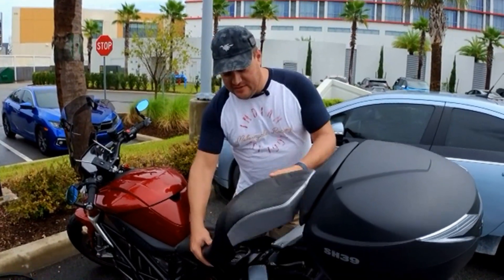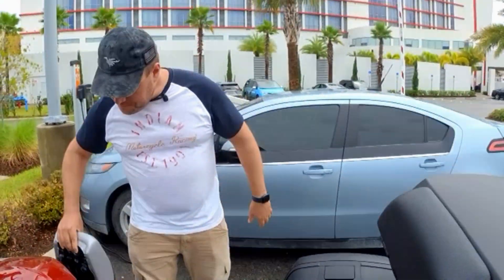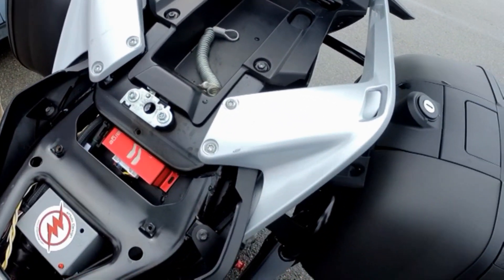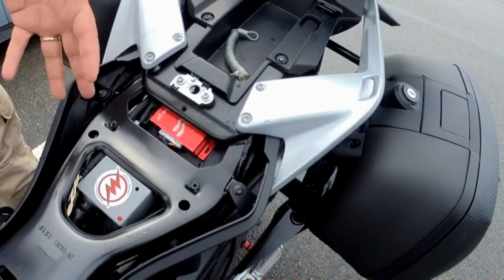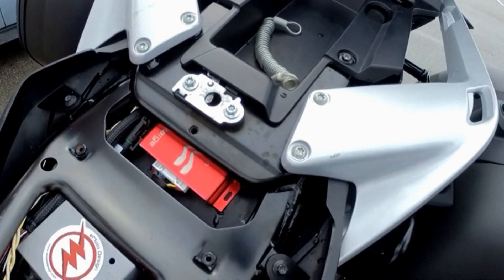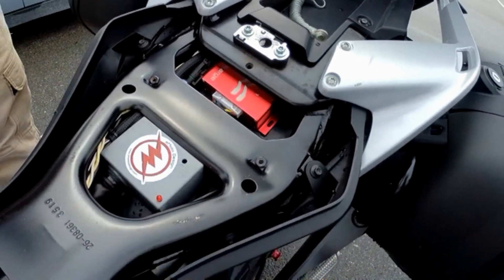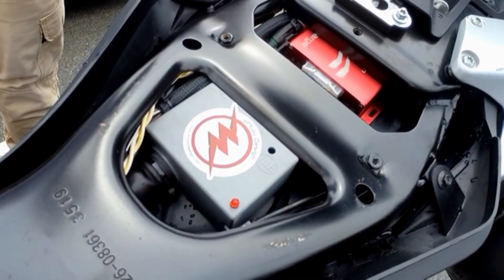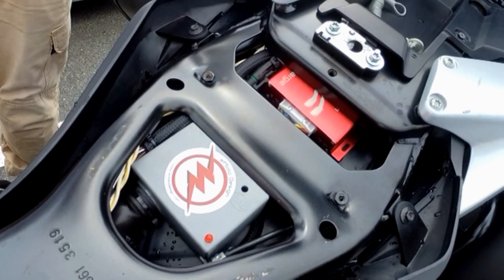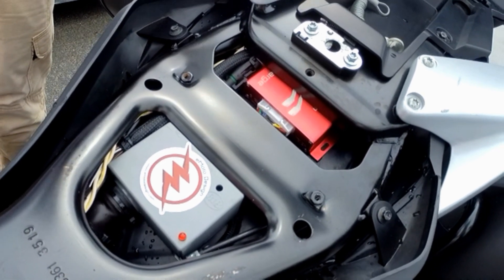If you care about the internals, they're under the seat. The main control box handles all the J1772 communications. And then there's a relay that basically reroutes power to the Rapid Charger — it's either coming from the auxiliary port or the main port. That'll give you the full 12 kilowatts on the main port, or automatically sense that you've got two plugs connected and pull six from each.